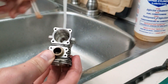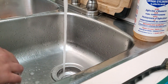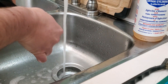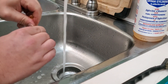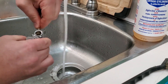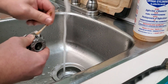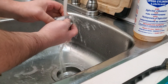You don't want to use hot or cold water — use warm, and work quick because Super Clean will discolor aluminum really fast and damage it. You should be wearing gloves because it's not good for you, but I don't have any. I've got a well-ventilated area going on here so I'm fine. Look how nice that came out with just a Q-tip — this engine is actually not that dirty, so we're just going to give it a quick once-over.